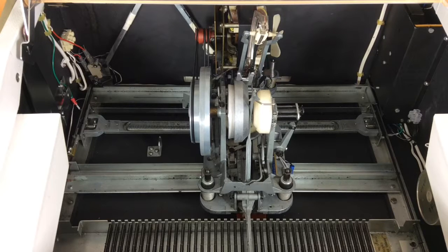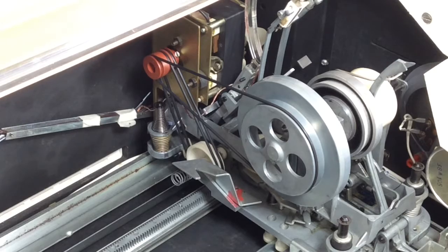This is where you need to resist a movement of your own — the movement to head for the WD-40 and liberally spray it all over. It might give you a short-term result, but all you're doing is storing up trouble for later because the WD-40 will lie on surfaces and attract dust, inevitably causing later problems. If you must do any lubrication, use sewing machine oil — not three-in-one oil, which becomes sticky with age, and certainly not WD-40.